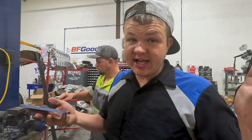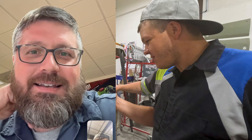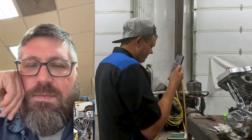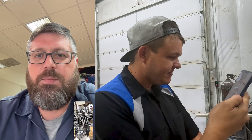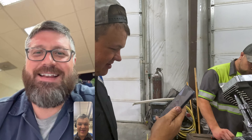If you guys haven't checked out Craig's channel, go check it out. He's a very, very smart human being. Good afternoon Craig, how's your new channel? Doing great, really stoked. We're super happy for you — it's the Bearded Mechanic, right? Correct. Make sure you guys check it out. You are the guy when it comes to this. It's got an Ultima 127 cubic inch aftermarket engine — we want to tear it down to figure out what's going on. We're ready to take the head off and get your take on how far down we can tear this down. You can go all the way. Can I make a prediction? You're going to pull the head off there — you're not going to see much. And then when you pull the cylinder off, that connecting rod is going to be loose on the bottom end. So you think our lower bearings are gone? Yeah, I think you knocked out the big end bearing on the front cylinder. I really appreciate your time and we're super excited about your new channel.